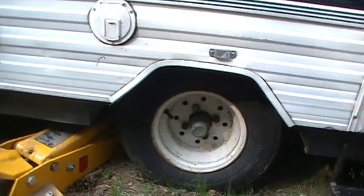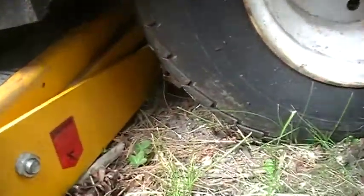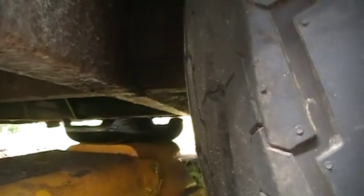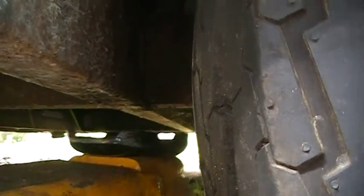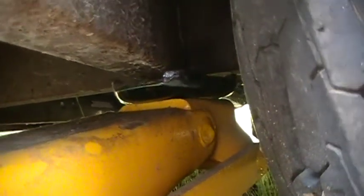There wasn't any literature and we had to safely jack this one up. The place to do it — this is a two-ton floor jack, but if you have a scissors jack or a cheap jack that you keep in your pop-up — you can place it right under here. You want to get it under the cross-member on the trailer, right where the two cross-members meet, preferably as close to the tire as you can that you want to service. So that's where the cross-member is, and it's going to come to rest right between the two crosses on the cross-member.